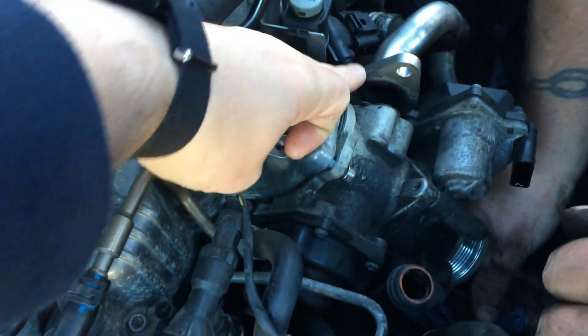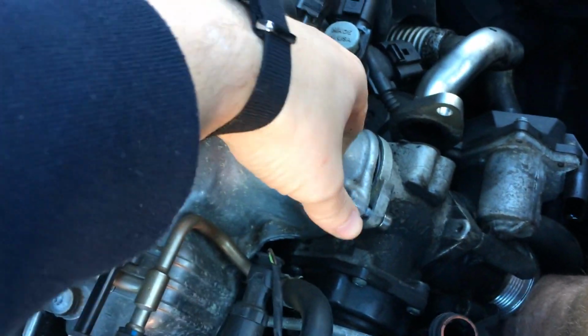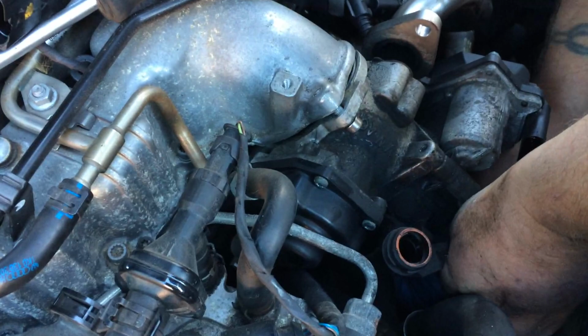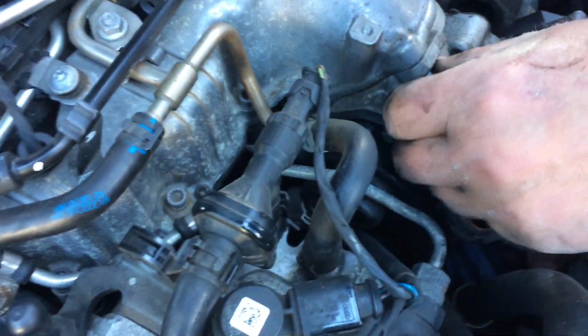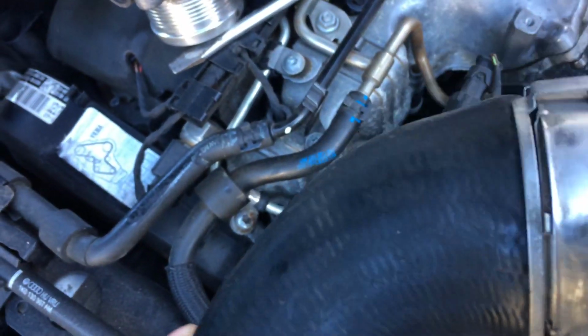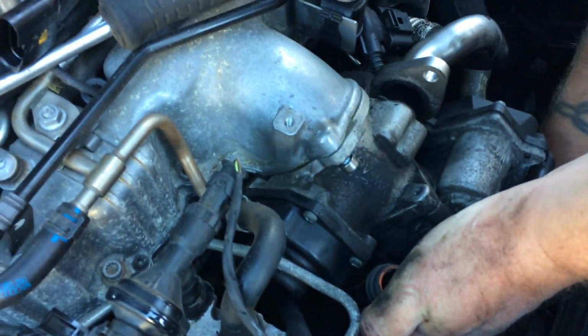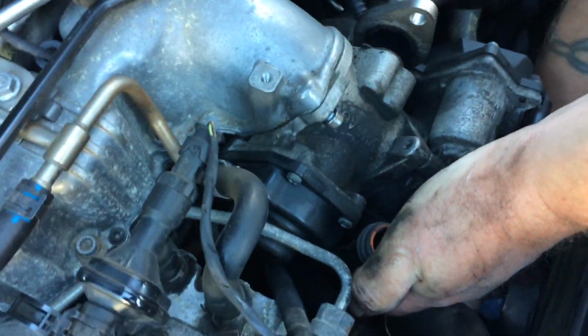Right, okay. Once you've undone the EGR pipe, to get the whole assembly off, we've got a bolt here, T27 Torx, and one that comes right up the back, threads through the throttle body and the EGR valve assembly. You've got a rubber hose you've got to take off first. A bit of wrestling, a couple of screwdrivers needs prying off. It's quite tight because it's old. The rubber's gone a bit hard. So yeah, just get up the back. Leave these bolts in so it's not rattling around too much. Get that bolt out the back. A bit fiddly, but it can be done.